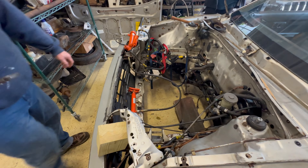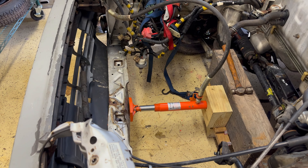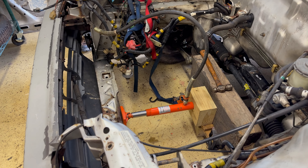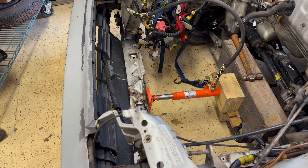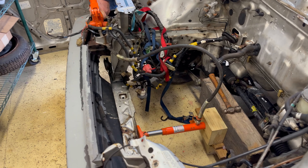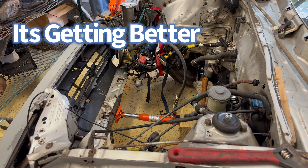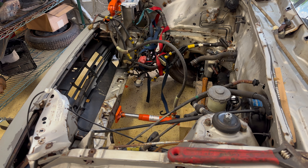All right, round two. We got to be careful about things flying up and hitting you — one kind of slinging away. It's actually working though. We're actually almost there. We've got to over-bend it if you want it straight because it'll come back some. We could put heat on it but we're not going to. You can hear it creaking — it's actually pushing it out more.